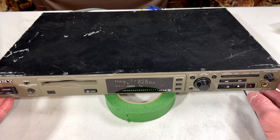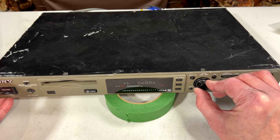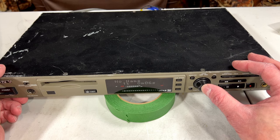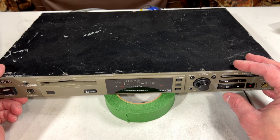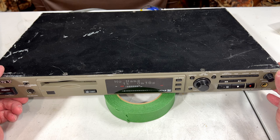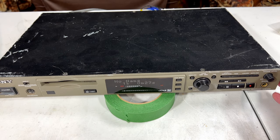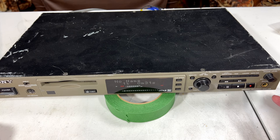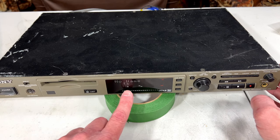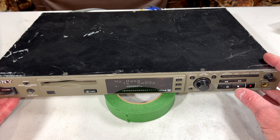Okay, DIN unlock refers to the digital source not being connected properly, so I probably should have taken a look at that switch while I was in there. I'm going to try the coax input here. I think we're running up between tracks here so I need to set the levels. I think it's actually recording now — this will do for a test. Yeah, levels are really low. Okay, that's a 34-second track I guess. Let's see if it plays — yes, she does.